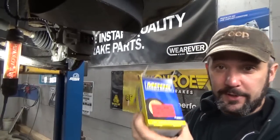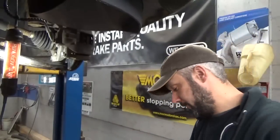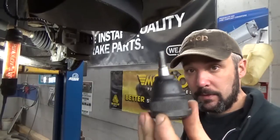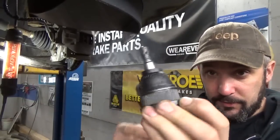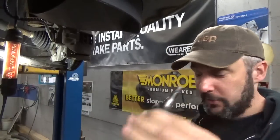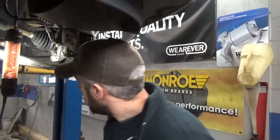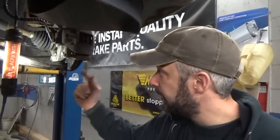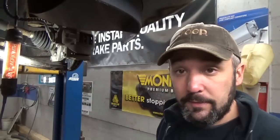So I got us a ball joint here, got a moved one. They are a press-in ball joint. That's what they look like. It's got the knurls on it, but we're going to press it in. New one's greasable. Shouldn't be too big a job. Just looks like we've got to separate the nut off it, and pop the steering knuckle off, and see if we can fashion something to press it in and out of there with. Should be in good shape.